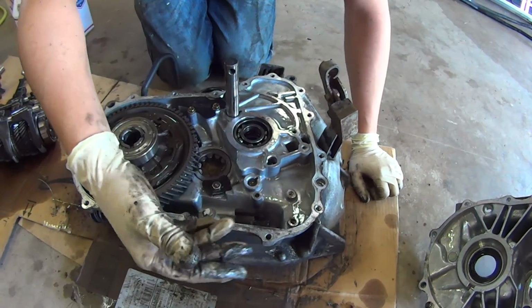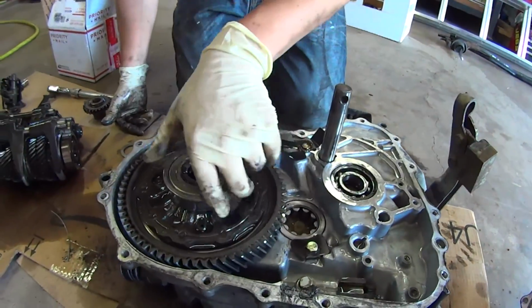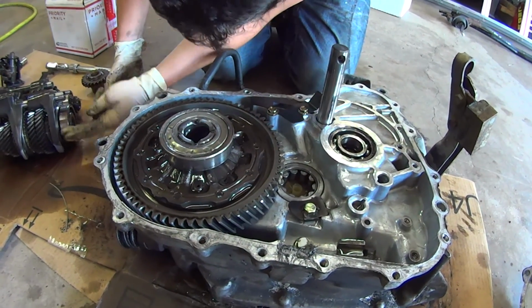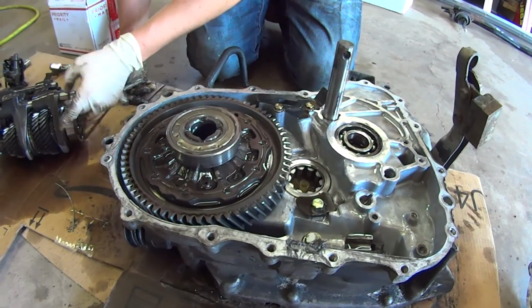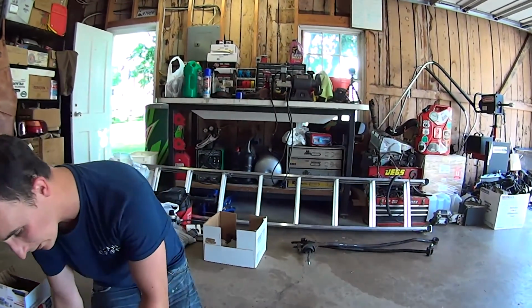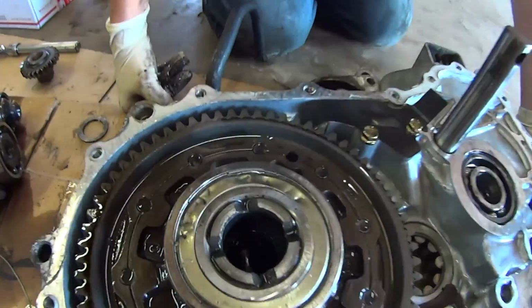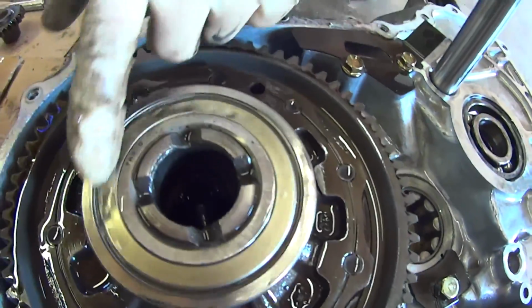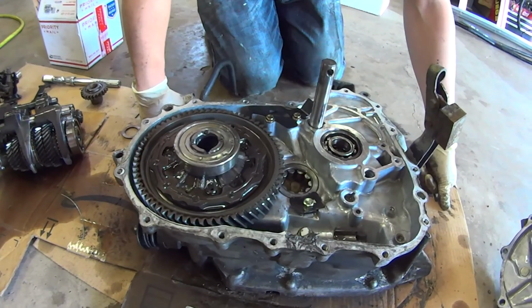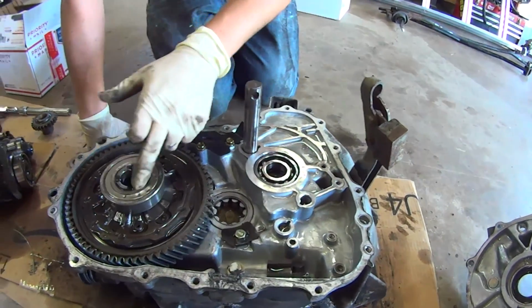I'm gonna have to replace like every bearing in here. That sucks. I mean, I think it's salvageable, but look, that one sounds pretty beat. I think you'll be alright, because the fluid didn't look metallic when it came out. So I think... Clean the magnet off, and I'll need to replace my diff bearing. Holy crap, look at the dents on that. Yeah, that bearing's toast. So the main diff bearing, or the final drive, or whatever you call it. You know what? You're in here, you might as well. Oh yeah, do the final drive. Wow, they bounced around and beat that up.